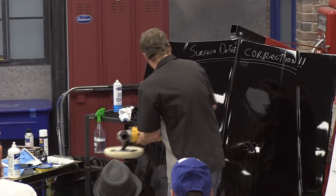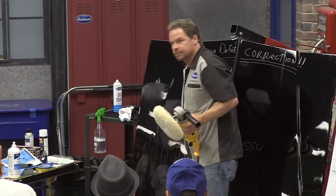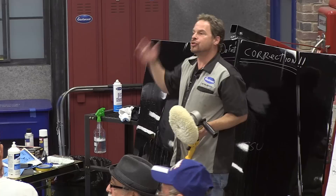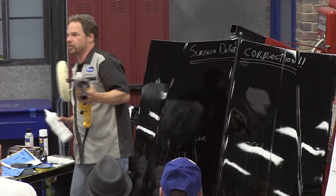Let the liquid sandpaper and the equipment do the work for you. Even on a side surface, I'm not hammering into it. Just like dry-on-dry is bad in the initial cut or initial application — rubbing all of your compound off — I'm not going to let that get dry before my next application of compound. Some guys put the compound on the pad, some guys put it on the panel — I just get used to putting it on the panel.